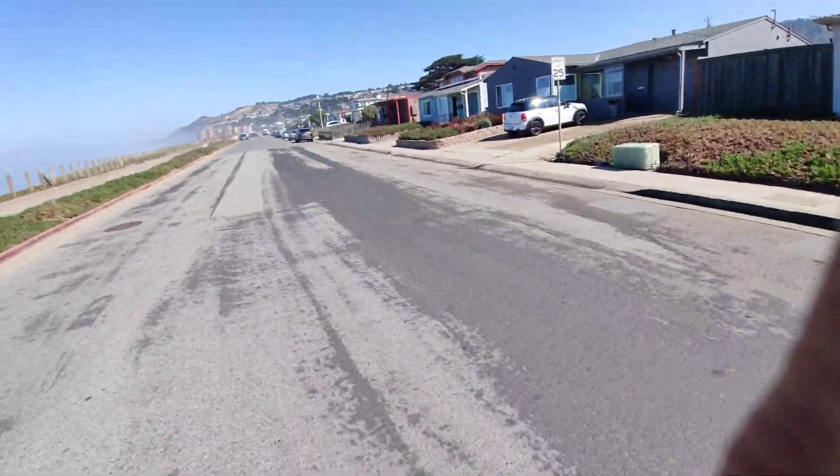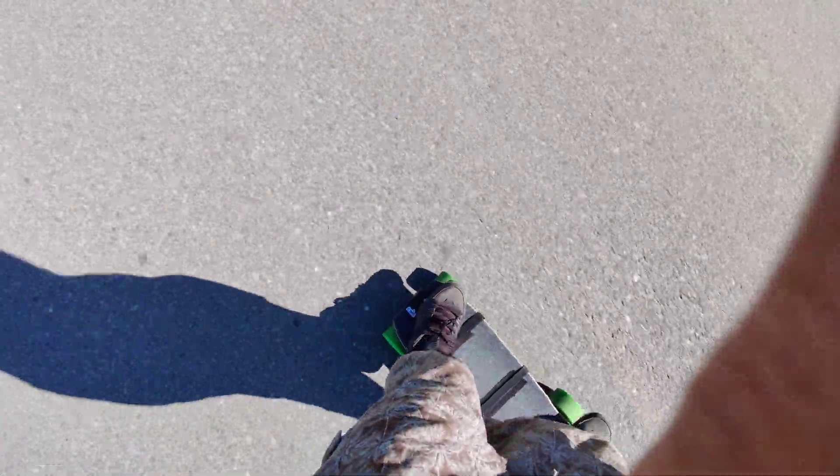This is like a street — I can use maybe half the street and make a full U-turn. That's really cool. The main reason I built it wasn't for speed but for nice carving because I want to get some exercise. This is made for flat ground — it's not made for hills. You could do little hills maybe up to fifteen percent, but you're not gonna do any steep hills. I made it for portability. I could have easily put another motor, but that adds more complication. This is a good setup: very portable, under ten pounds.